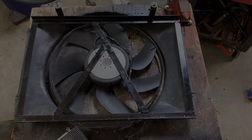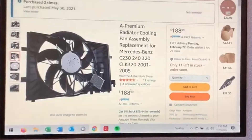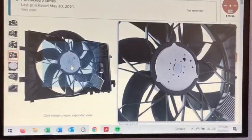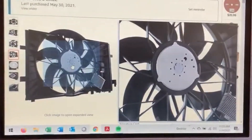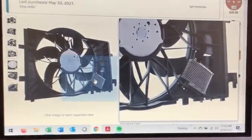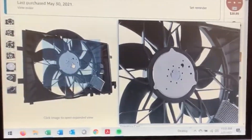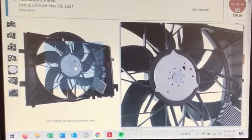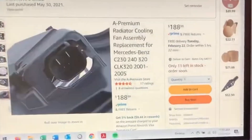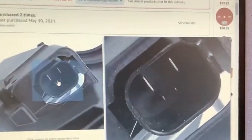Here's a good detail of the back of the motor — you can see the motor mounts, those three ears that come off of it. I took the fan blade off and you can see those mounting points from the front — just unscrew it and take it out. Same goes for mounting the control module — it just unscrews and comes loose. Then I had to drill and tap those ears to accept hardware, which wasn't a big deal, and I just mounted it to the case I made.